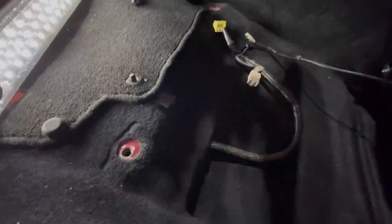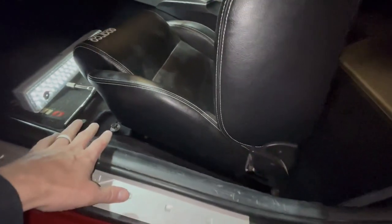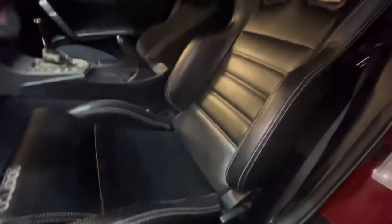Things lined up. Getting underneath to hook up the seat belt plug — plugged in. Using this little cubby spot to tuck the wires. The smart thing to do is get all your bolts started just finger-tight to make sure everything lines up. If you start tightening them down you'll never get the bracket to align — even some of the highest quality brackets get a little warped. Got them all finger-tight and threaded in, now we'll lock them down.